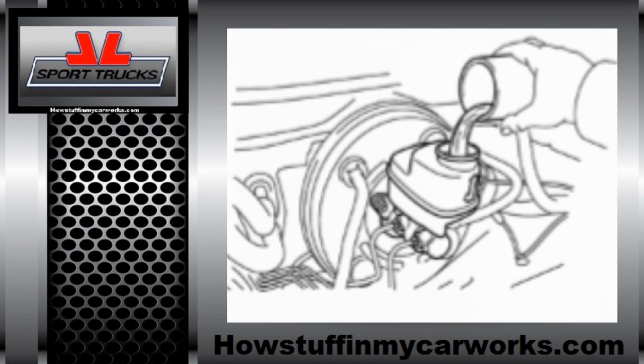Remove the tape that you installed on the brake fluid reservoir and add brake fluid if needed, and proceed to bleed the brakes, starting from the right rear wheel, followed by the left rear. After all the air has been bled, fill the reservoir to the full mark and install the cap back on.